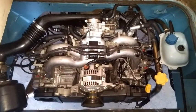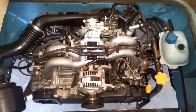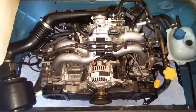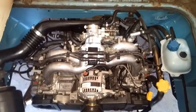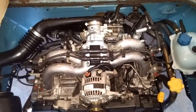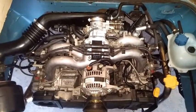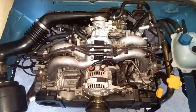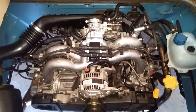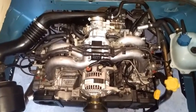So there it is. This engine is definitely one of the smaller of the Subaru family, but it definitely does the trick. And it's legal here in California, so we can install these and not have any problem passing smog. Besides the engine swap, there was also a transmission swap. This van got a later Vanagon transmission, rebuilt, with a taller fourth gear. That's mainly because diesel transmissions are not suitable for this conversion due to their low gearing. You don't want such low gearing with a higher output engine like this.